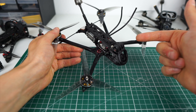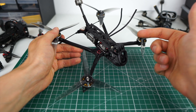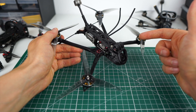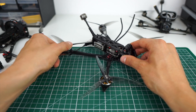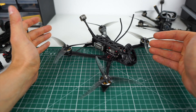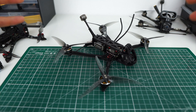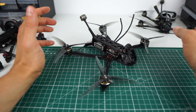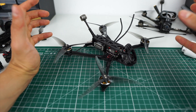It will be above 250 grams with all equipment, which raises the question of why not just go with a classic six or seven-inch long-range build. What would justify this class of very light freestyle long-range quad is being more stealthy and quiet. With a bare weight of around 200 grams, it could be way quieter than a seven-inch — drawing way less attention. Extremely loud quads scare people, and I hope this could be as stealthy as a micro long-range while being able to carry an actual GoPro.